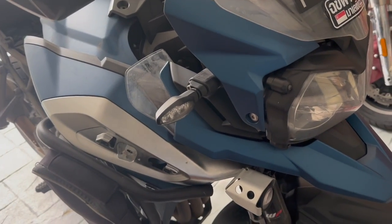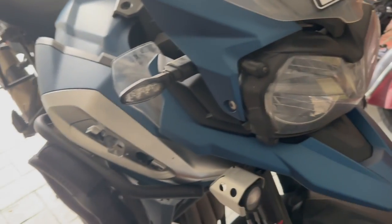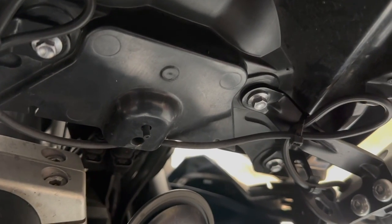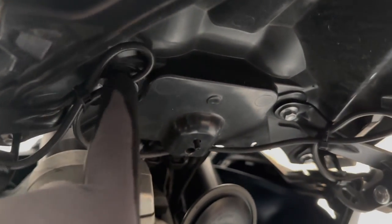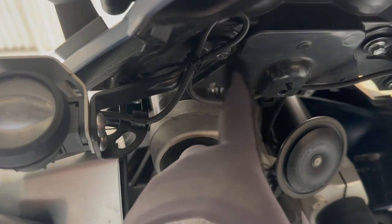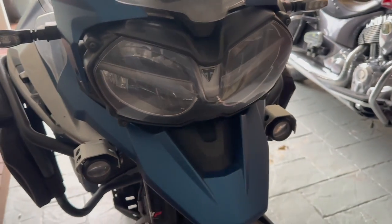I'm going to try something else that might be easier: if I take out the wind deflectors and the beak, I should be able to pull the panels out from the top. That might be easier than removing the crash bars. To take out the wind deflectors I just need to remove a 5mm screw on each side. For the beak there are four 8mm bolts underneath — I have fog lights so the fog light bracket is attached to one — and then the beak should come out. Let me try that.